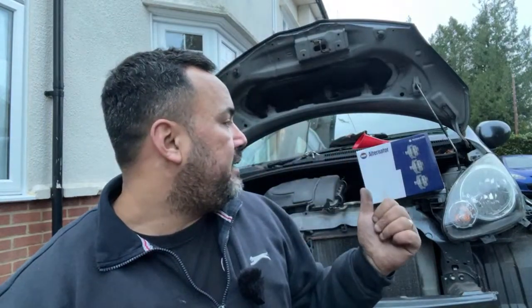Perhaps I'll do one video with all the problems fixed, which is going to be the front bearings, the clutch adjustment, because it's really high. You only have clutch when it's just about to come off the clutch pedal. And then the alternator, replace it. It's working, but we replace it, because we know there's a problem there.